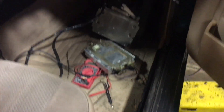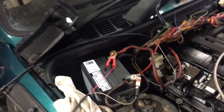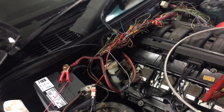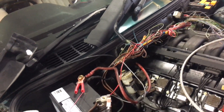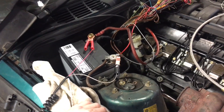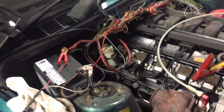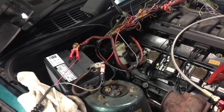Well, I'm back out here just before the new year. I brought a Virgin 413 red label computer out here to see if my fuel pump not priming was due to the ECU. It is not, so I do have a voltage or ground issue going from the main engine harness to the computer — at least that's my best guess at this point. The harness is a little bit hacked up, but really it isn't too bad. I'm guessing something just got accidentally clipped, so I'm still digging through my E36 Bentley manual trying to find the pinout for the ECU plug. I'm going to manually ground everything and give everything power that needs it, and hopefully we'll get fuel pump priming. That's always the last little bit of every project that takes forever, and this car is no exception, so stay tuned.